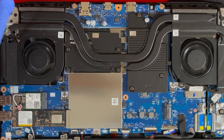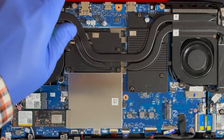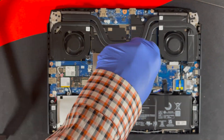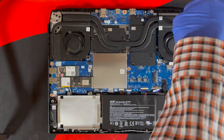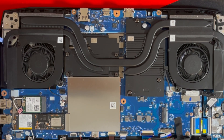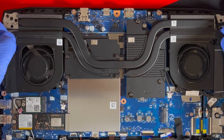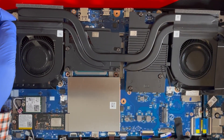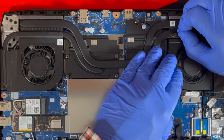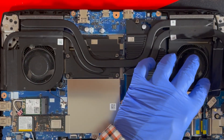Moving on up, the two fans will also need to be disconnected. I'll get these along with four screws holding them in, as well as seven for the GPU and CPU. Sometimes the heat sink will be hard to remove because of the pads and grease holding them down — lift slowly and make sure the screws are retracted. The seven over the processors will not completely come out. I ran into a problem where the display cable ran under a pipe then on top of the fan. You can fix this by lifting the tape and leaving the fan in place.